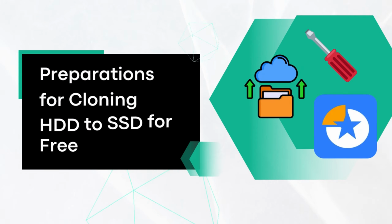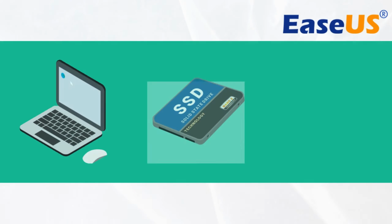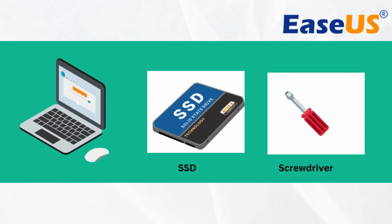Before cloning HDD to SSD, there are some preparations you need to make. First, prepare a Windows computer and a new SSD whose capacity is larger than the used storage space on your HDD. Then, make sure you have the proper screwdriver to unscrew.